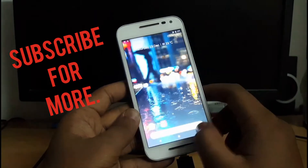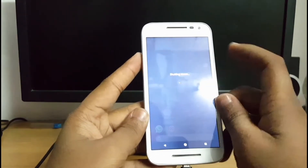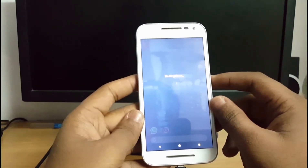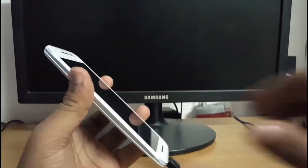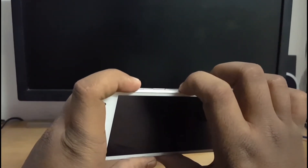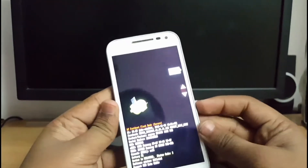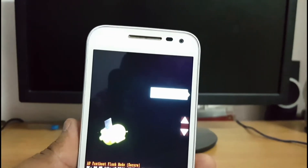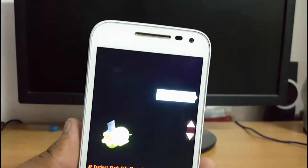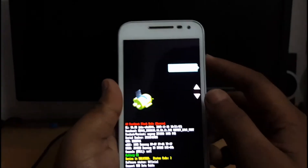As I am using Android 8.1.0, I'm going to show you how you can flash the ROM to your device. Let's power it off. After switching your phone off, you need to jump into the recovery. For doing that, press and hold Volume Down plus Volume Up and then hit the Power button and release them quickly. Then go to Recovery Mode by pressing the Volume Down button, and hit Power button to select it.